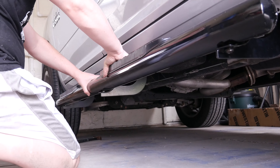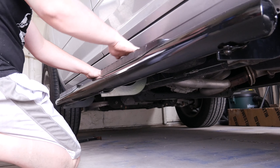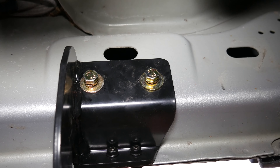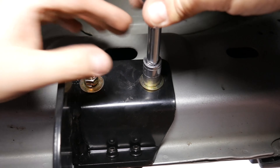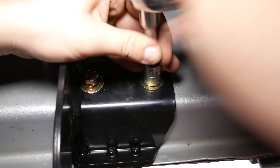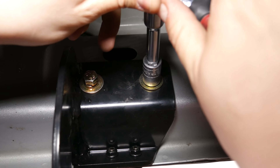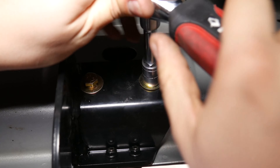Getting it nice and snug and getting ready for the adjustment of the rail. Just making sure that it's level — make sure the brackets behind it are level. The step rail is level where you want it to be. You could break out an actual level if you wanted to. Now here's the important part: you want to make sure that as you're tightening these riv sets down, they are nice and snug against the frame. You need to put pressure against the bracket as you'll be crushing them against the frame and permanently installing them into the truck as you tighten these down. There's a great video on how these actually function — I can put that in the description below, so if you want to get a better idea of exactly what you're doing, you can check that out.